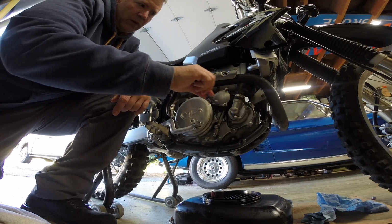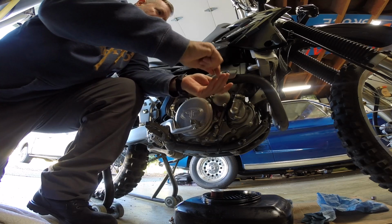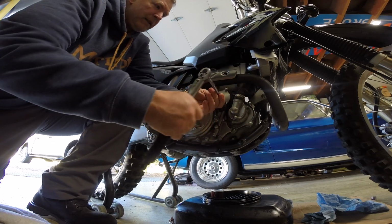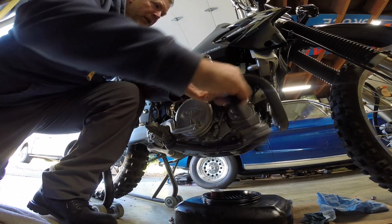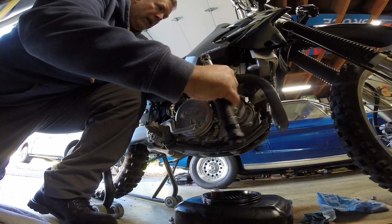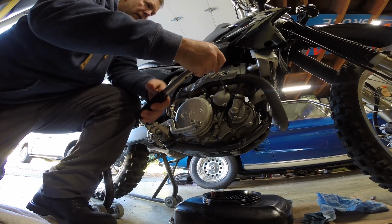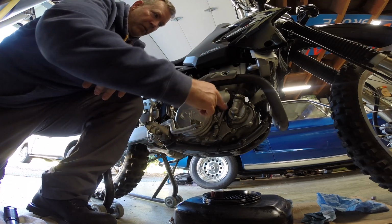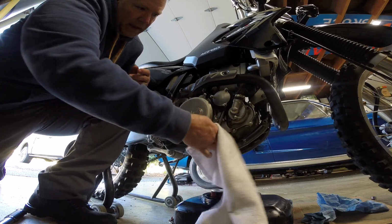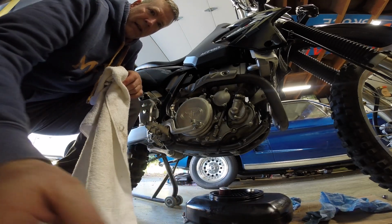By the book, you're supposed to tighten these one at a time, kind of equally going around. You can feel that they're bottomed out by hand. Doesn't take much. So I've got my torque wrench set to 96 inch-pounds. A little bit there, a little bit on that one, a little bit on that one, that one. Okay, that's it. That's all there is to it. 8 foot-pounds, 96 inch-pounds. All right. And so the only thing really left is to add oil to this thing. So that'll be next. And we'll get back to that.